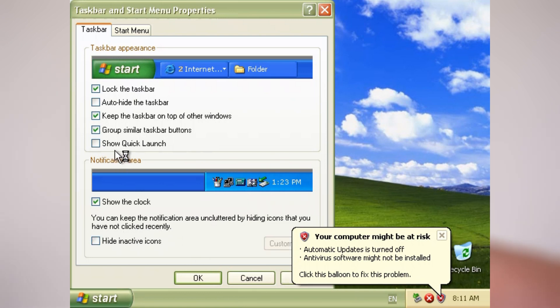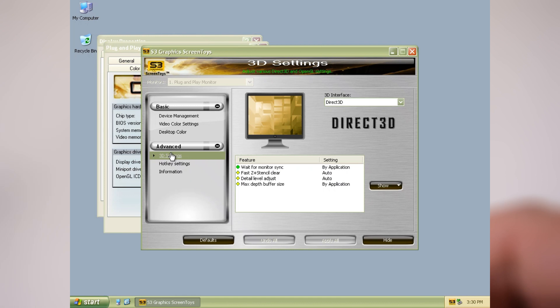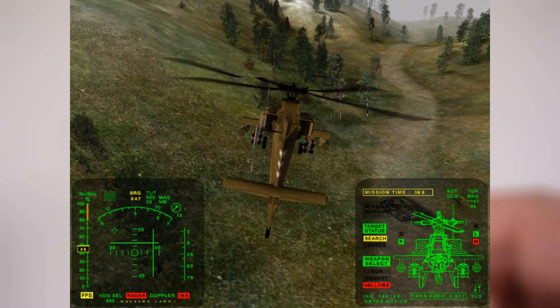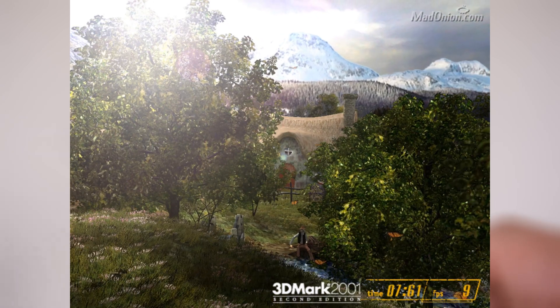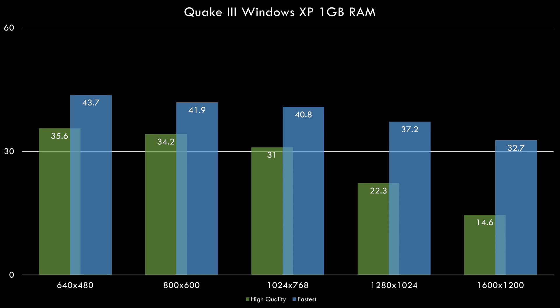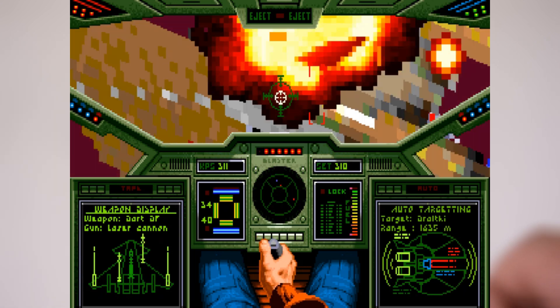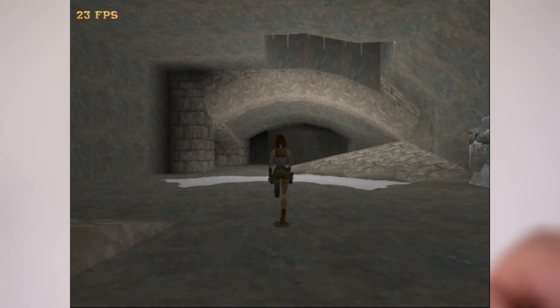Very impressed with the video card drivers — it's the first time I'm seeing 3D card options like vSync with a thin client that uses a VIA graphics card. Performance unfortunately is a bit limited. In 3DMark 2000 we're getting 1,856 and in 3DMark 2001 only 1,242. We also benchmarked Quake 3 with two detail settings across all resolutions — not very much performance going on here, so you have to look at even older games. I then ran DOSBox and older games like Wing Commander run really well, but the machine runs into difficulties with something more demanding like Tomb Raider with 3DFX emulation — it's playable but doesn't reach 30 FPS.